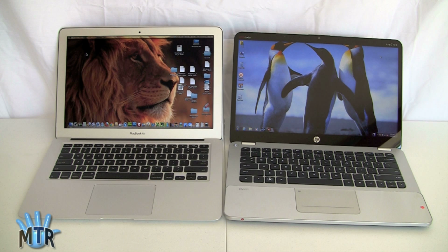Both of these guys have Intel HD 3000 integrated graphics, which is perfectly capable for 2D work and play 1080p video. You can do a pretty reasonable job with Photoshop, that kind of thing. Even some video editing, though. Really, you want to look at 8 gigs of RAM if you're doing a lot of 1080p video editing, and honestly, I would prefer a faster CPU too.